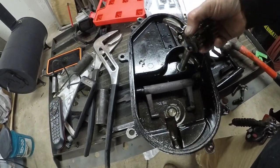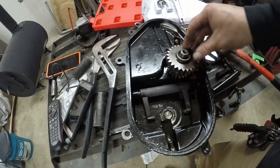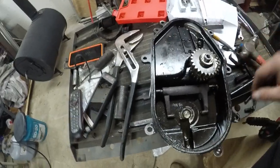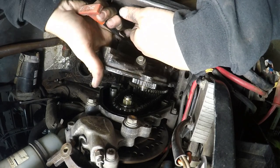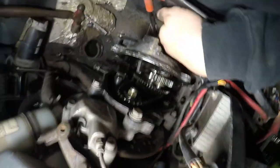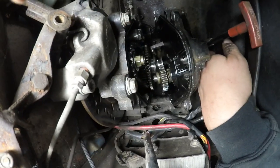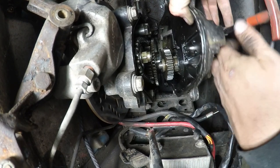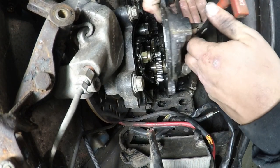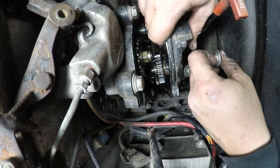So that's all ready to go. There's my spacer on there — make sure your spacers are in there, gear stack, other spacer, side cover ready to go. Now with the shift fork down at the bottom, I have to hold on to that lever right here with one hand.